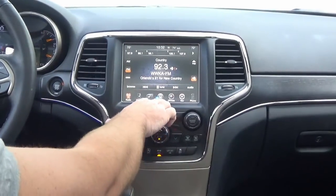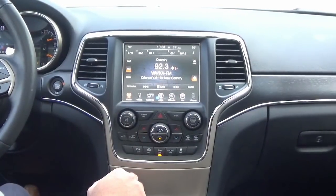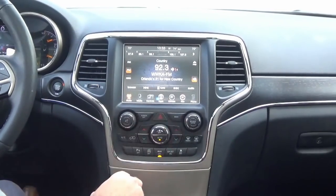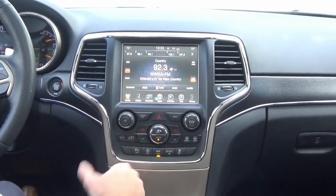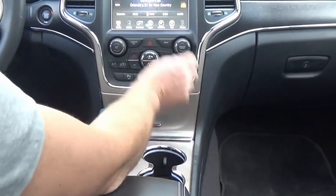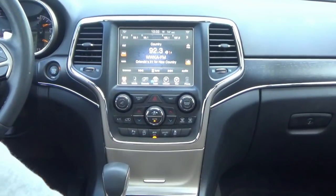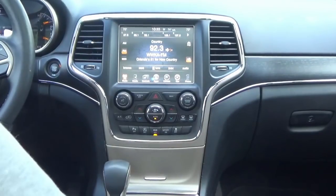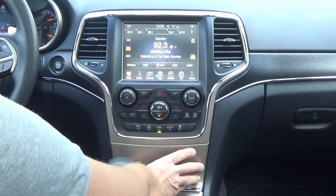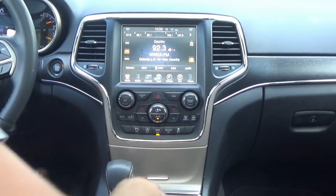On this particular model we're in a 2016 Grand Cherokee, and this one already has the 8-inch screen. What we're going to do today is demonstrate how to upgrade to the CarPlay/Android Auto unit. To do so, it's really easy — basically we're going to replace the USB hub in the back and then replace the infotainment system itself. To get started, grab a 7-millimeter socket and a dash pry tool or a regular screwdriver.